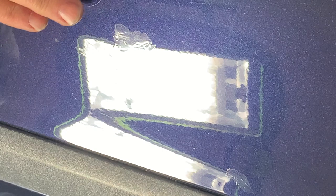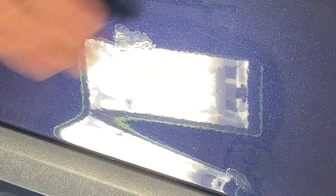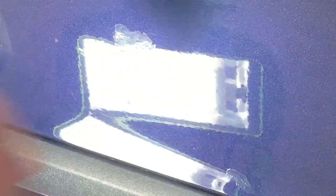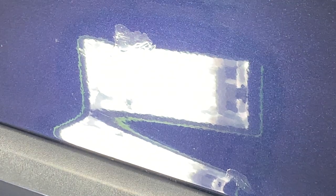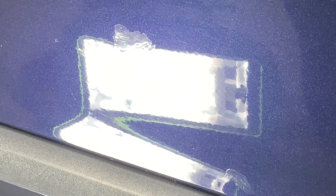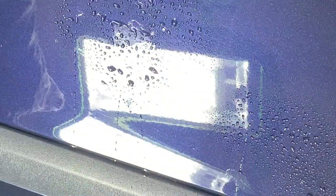When everything works right, it almost makes this patchwork completely blend in and you never can see it. I don't know if I'm going to be that successful here, but we'll try and I'll show you as I'm going. So the first thing I do is some wet sanding and I'm using 1500 grit sandpaper. I'm using it around the sanding block. And when I say wet, I mean we're making it wet — putting water on it and then just lightly sanding.